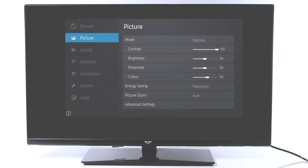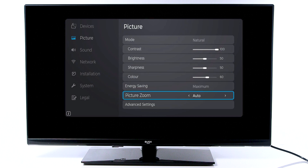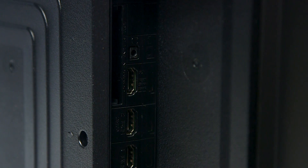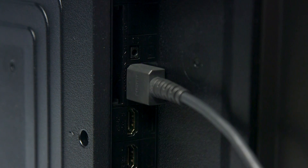You can also check the picture settings of the device with another TV. If it works with another TV, try adjusting the resolution rate and picture settings and then connect back up to your TV. If it still does not show signal, try using an alternative HDMI cable or a different HDMI port on your TV to establish a connection.